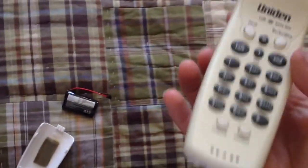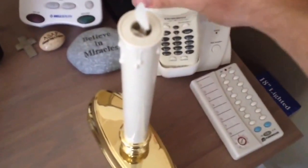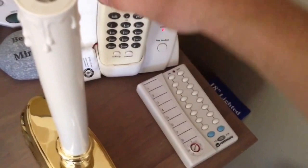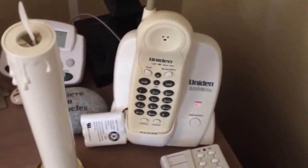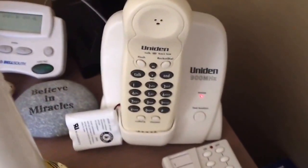I've got this battery installed. It'll probably even work this phone — and yes, it does. So what I'm going to do here — it doesn't fit properly — but I'm going to throw this in charge here just for about 2 or 3 minutes. I'm going to leave that charging for about 2 to 3 minutes, just enough to bring the voltage up a little bit, and then put it back in the other telephone and it should begin to charge.